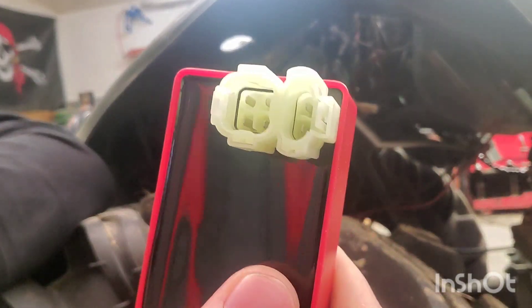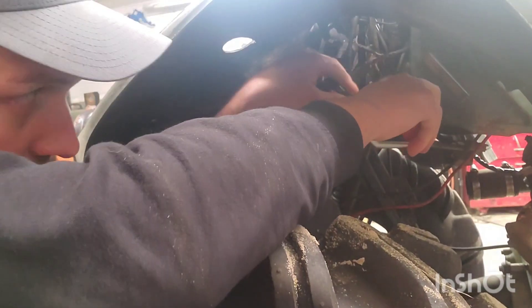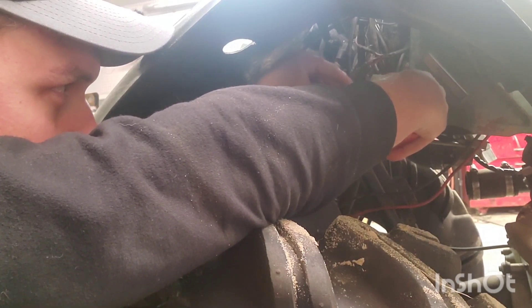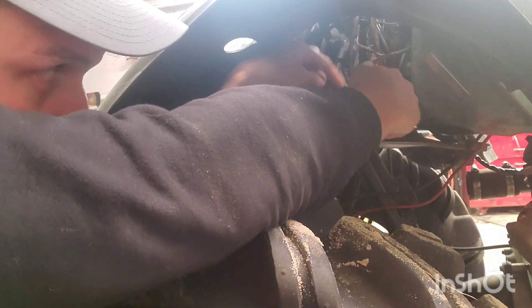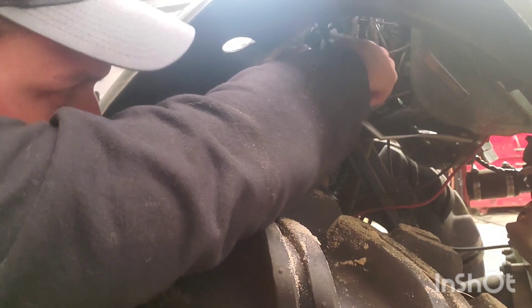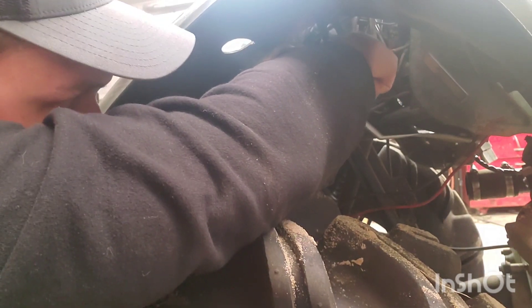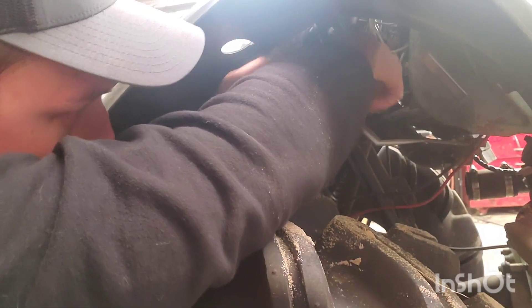This one doesn't have any mud in the connectors. So this is a 4-in-2 plug — obviously this has been changed before because it's relocated nicely right here to the front. All I've got to do is make sure I put them back in the correct orientation so I don't short this one out, because that would not be fun. You just want to look at your retainer clips and make sure you're putting your plug in with the retainer clip in the right direction. So that's in. That's in.